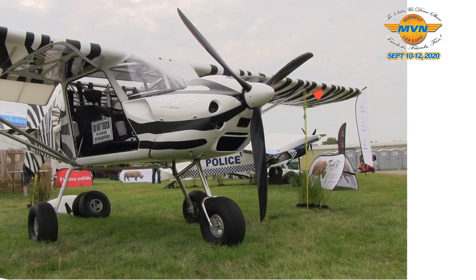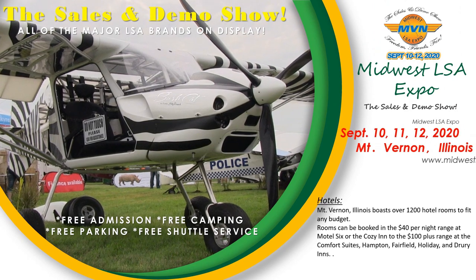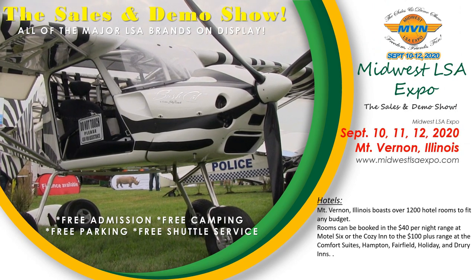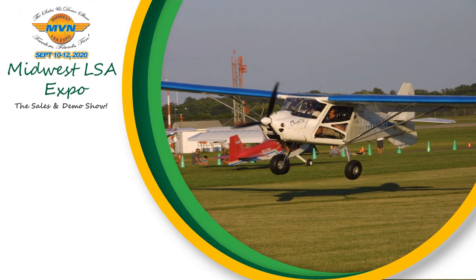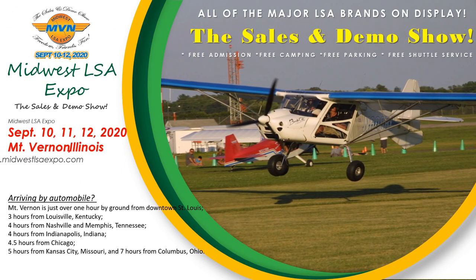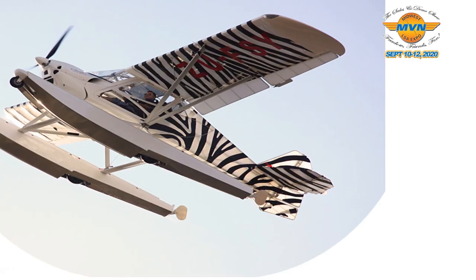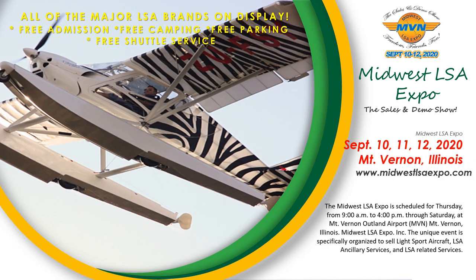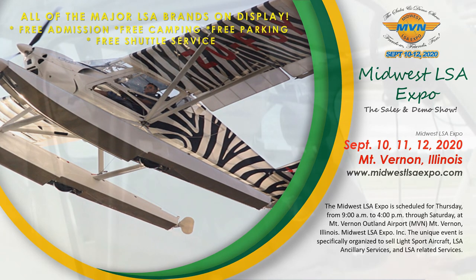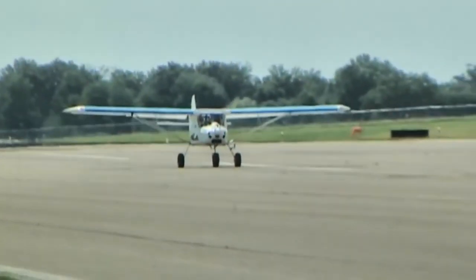But even if it does need to be replaced, it's a kind of slip-on cover. It pulls over the wing, it laces down. There's a few places on the airplane where you can see some lacing, and that's what that's about. This is not a dope and fabric covered wing, which also means it doesn't have to be painted, which means it doesn't acquire the weight of painting, much less the cost. Paint is not cheap, and much less the effort. It takes some time to do painting. It's almost an art form.